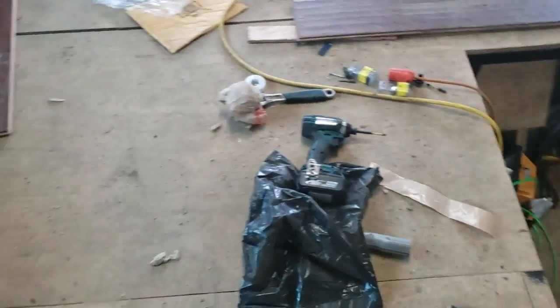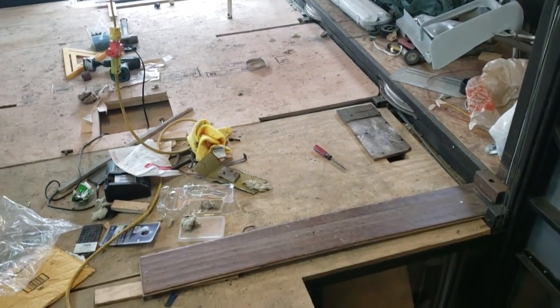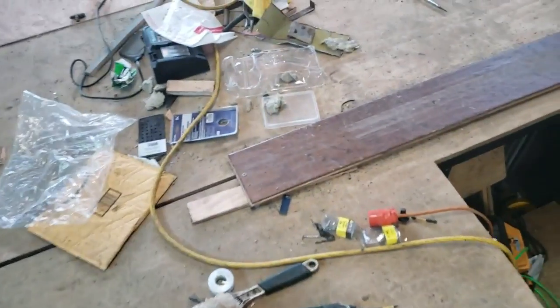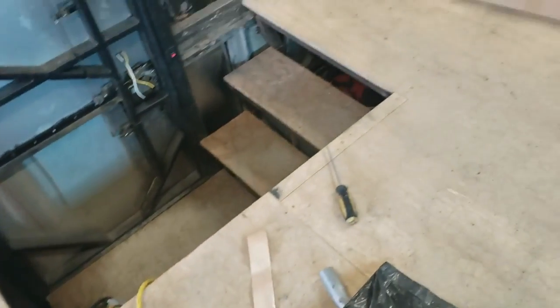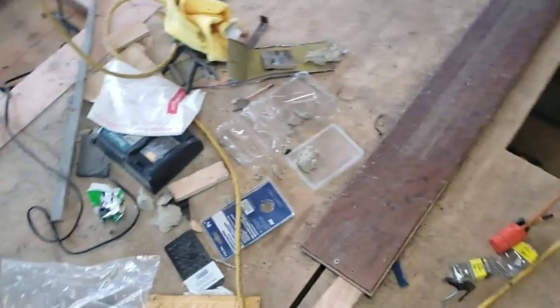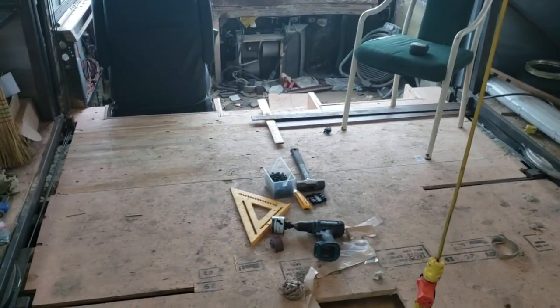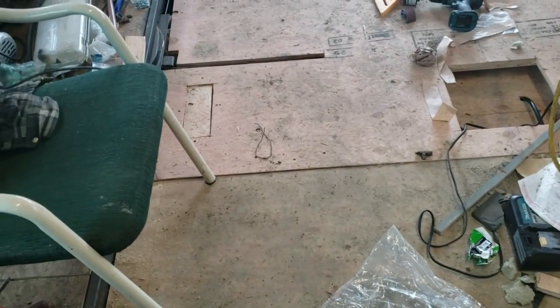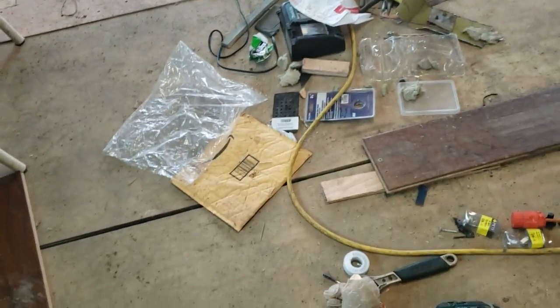Because of the way the cables for the slide outs work, that's what I have to do. So from about in here, top of the stairs, beginning of the kitchen, back to about in here, I'm going to have to taper it with some flooring compound, self-leveling or something like that, before I put the floor down. But from here on forward will be 3/8 plywood on top of that 3/4 inch. I need 3 sheets of 3/8 to do that.